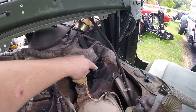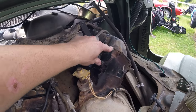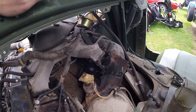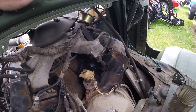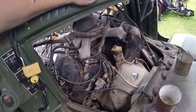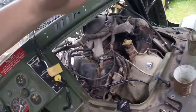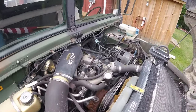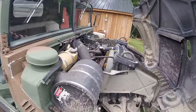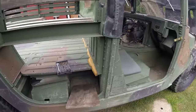There's also a grounding wire for the engine that has to come off, so I need to disconnect the battery. And here's the access hole on the other side — you can see that figure-eight shape. That's where those hoses go. They're pretty high up so you don't need to drain a lot of coolant.